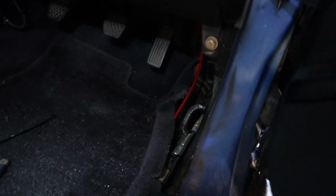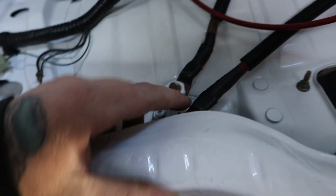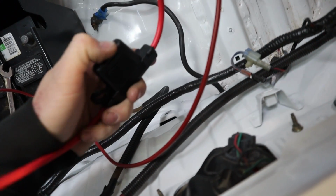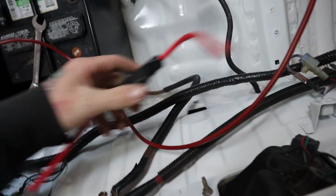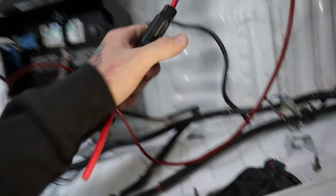So you can see my red wire coming from right there. It's tucked up because my motor is behind the plastic. Ran along here, inside the frame here, coming out here. I do have a rear kill switch that goes to this guy where my keyhole is. So this guy right here, I'm going to go ahead and just terminate the wire here because this is just battery straight to here. And to my understanding, this has to go, more ideally, back here by the battery. So I'm going to go ahead, trim this out somewhere right here, and we'll crimp this in. The way to do this, there's normally a tool for these kinds of connections. Granted, right here is just going to be more of a butt connection, solder joint type connection.